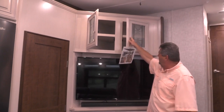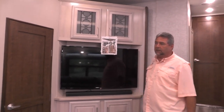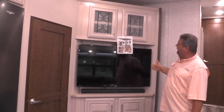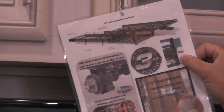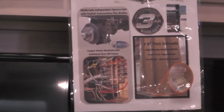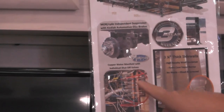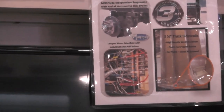There's good overhead storage above the TV. For a toy hauler, there's always some give and take in room when you get a garage, but this one has ample storage space. DRV builds with a 15-inch box frame that steps down to the lower deck and remains a 15-inch box frame, using box gussets instead of flat gussets. The frame tube structure is two sixes and a three-inch welded together, with a three-year structure warranty. The JX390 has independent suspension standard, with each wheel working individually.